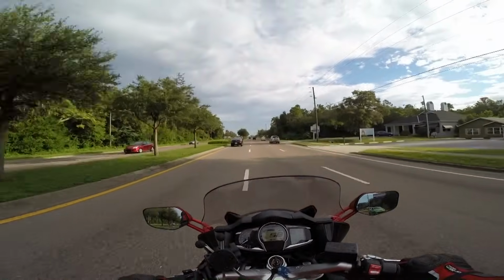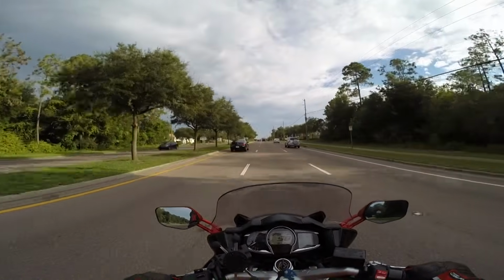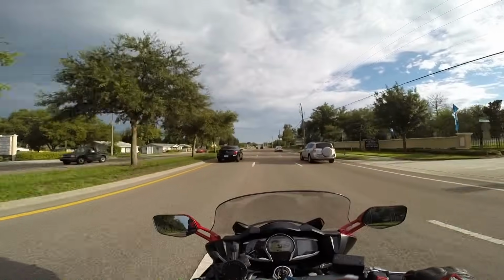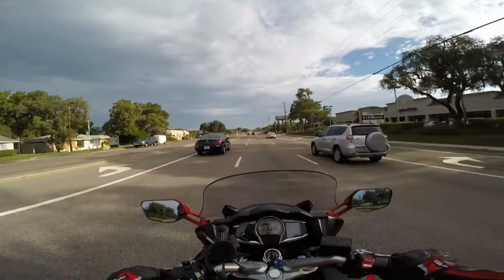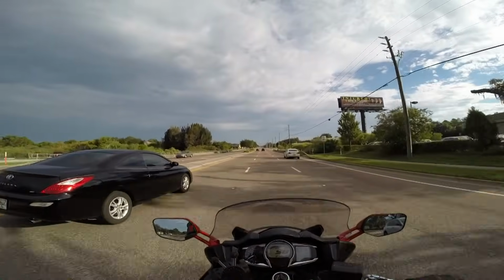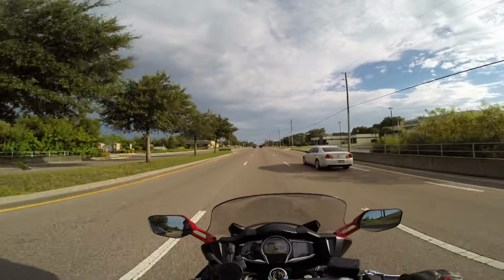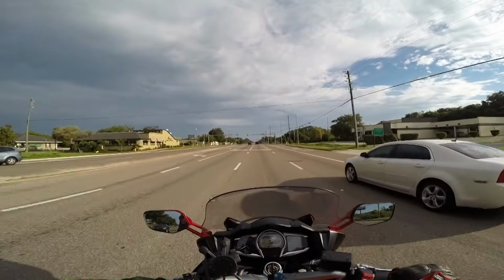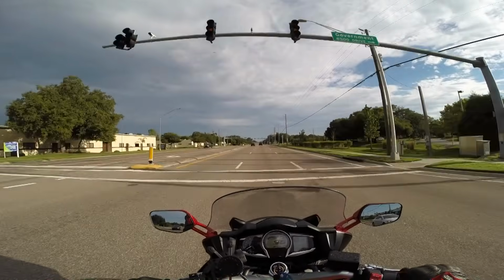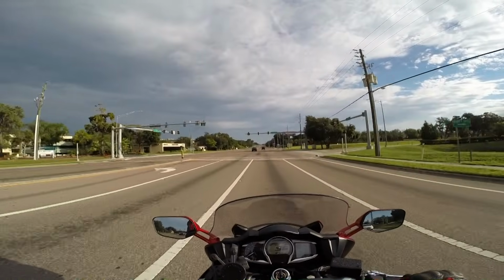So the optional one from Yamaha is a different angle. It removes the back curve that the stock one now has, and it's 4 inches taller. Now I talked to a couple people in other hot climates, and they said they have it, and in the low position you still get enough wind on you, and that's critical. If I put on a windscreen and in the low position I don't have a lot of wind hitting me, I can't use it because I need it for cooling.